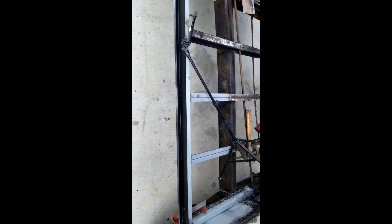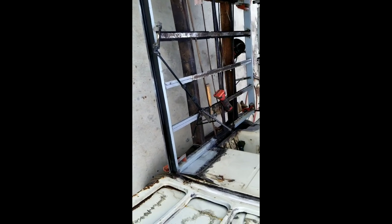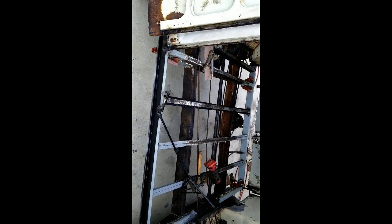How it looks is not as important, especially in something like this where you are going to grind it down and paint it. Before I put the rockers on I always paint back there - even if it is just a small coat of paint. Typically that area is not going to see any weather, it just has to be sealed up enough. I have to put one more coat on this one - you can see I got some runs, but there is not going to be rust there. I am going to be doing a lot of grinding and there is no sense in showing you all that, but I will show you after we are done in more videos to show you how it turns out - and it turns out really nice. Please like, share and subscribe.